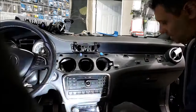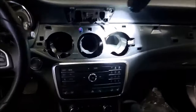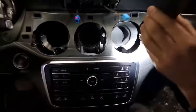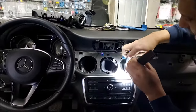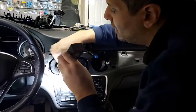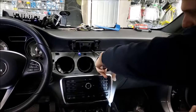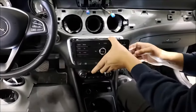Now we have access to the radio — you can see the two screws in here, one on each side. Again, you open them but don't have to completely remove them — they actually have a limiter that tells you how much to open. After you open all the way to the limiter, that's all you need. Now with our fingers we pull them out, and as you can see the radio just slides up.